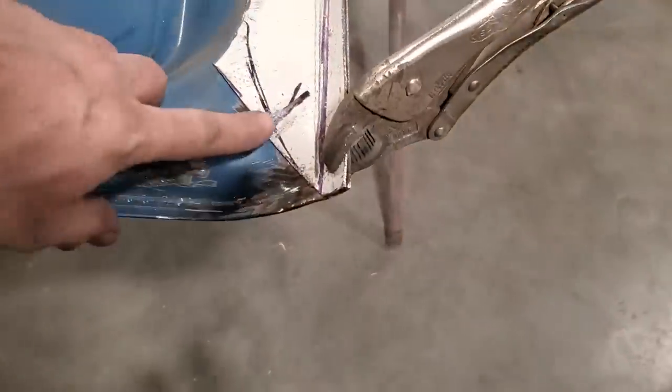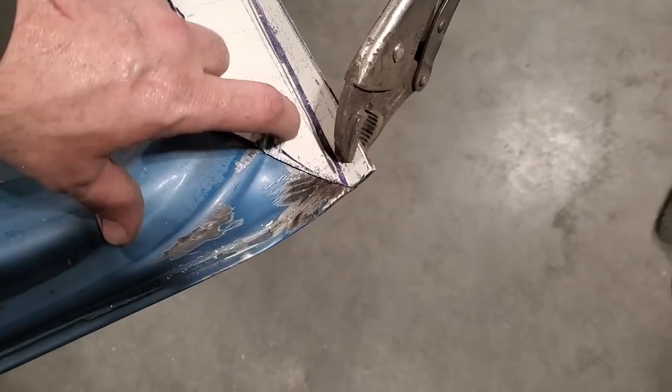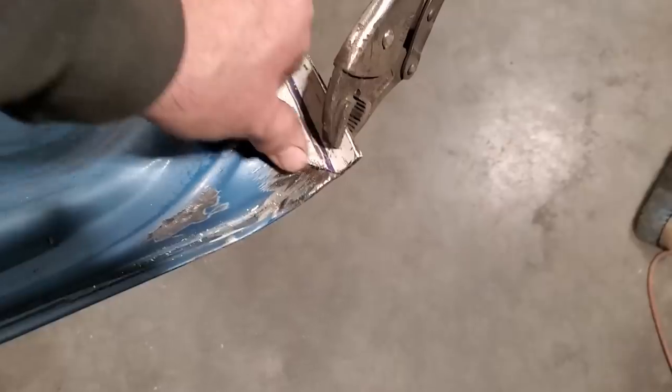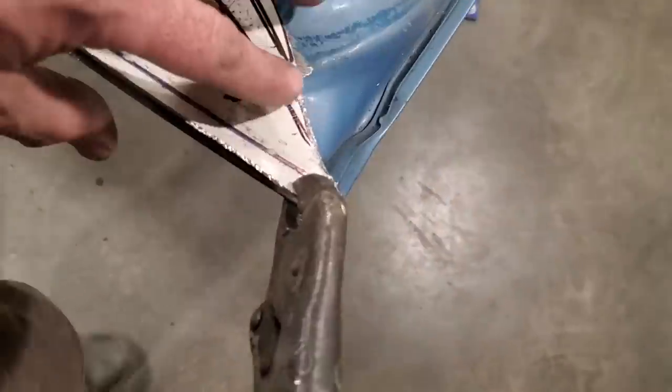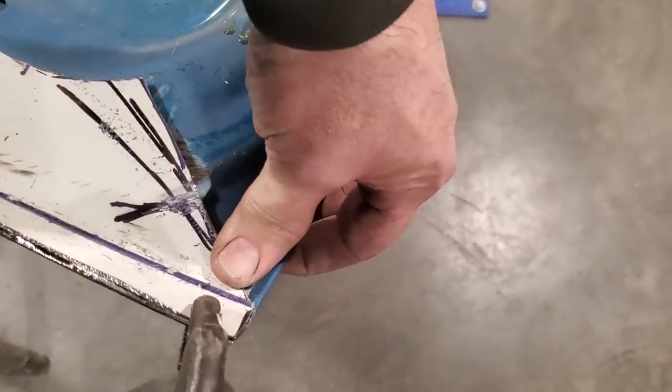So as you can see what I was doing there, I was using the actual trunk lid to get the shape of it to go down, or this here kind of flows into the here now, and I got that there, and I can push down it. That can be butt welded along there. Okay, I got the lip along, done along there, same, done the same thing over here. Used the hammer and dolly to go down this here, and that there can fit there nice.